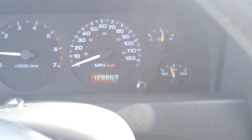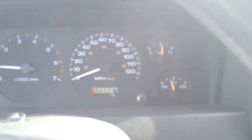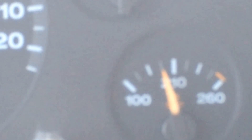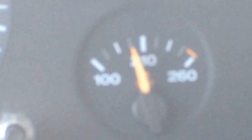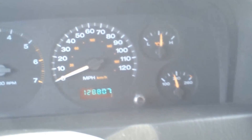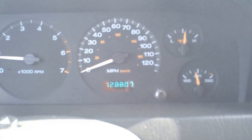I've got the thermostat installed, new coolant in there, new electric fan — everything's the same. The only things I changed are those two small mods: dropped the temperature 10 degrees on the thermostat and made that little slit. I also added Water Wetter because I think it's a really good additive. I've been driving it with the engine idling and the temperature is running pretty much the same at idle, but I had absolutely no problems filling up the coolant or getting air bubbles out — none whatsoever. When you drive down the road it cools about 10 degrees more and the fans hardly come on at all.